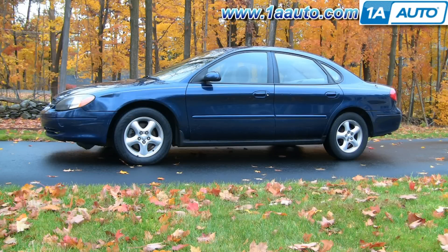In this video we're going to show you how to service the transmission on this Ford Taurus with a 3-liter and an automatic. Tools you'll need are a 10-millimeter socket and ratchet, and you'll obviously need a catch pan — possibly two, because it is a large pan — and then you'll need 7 quarts of Dex Merc transmission fluid and a new filter.